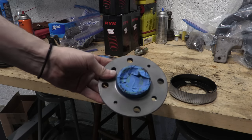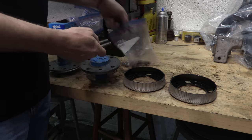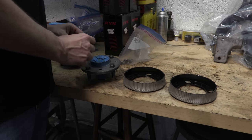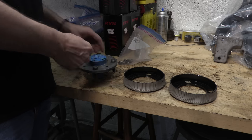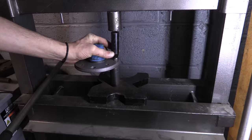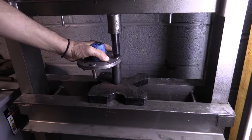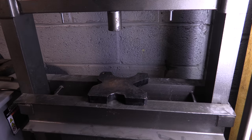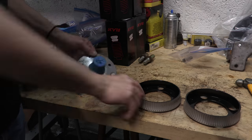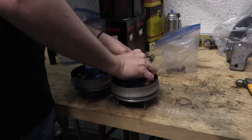It took me about 10 minutes to clean all the fasteners up, and it was really nice to visit my home garage for the first time in a few months. All my time's been up at the shop lately. The clear coated hubs look amazing for their age — I just need to press in the eight wheel studs and bolt the abs rings back on, because the assembly is pressed into the hub bearing as the last step before bolting on the wheel. This is where you drop your sockets on the floor 300 times while rigging and pressing in on the eight studs. I didn't clear coat the outer rim of the ABS ring, but my plan is to clear coat all of this as an assembly once it's all back together.